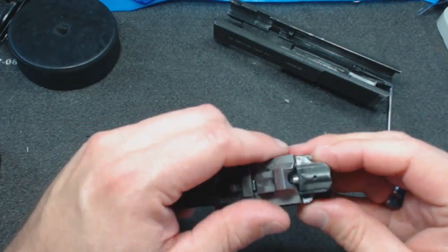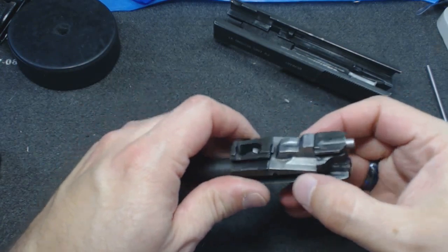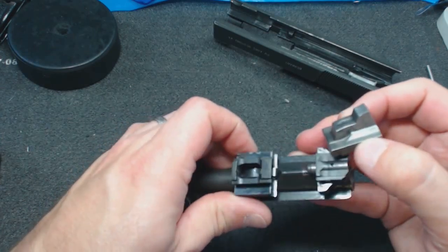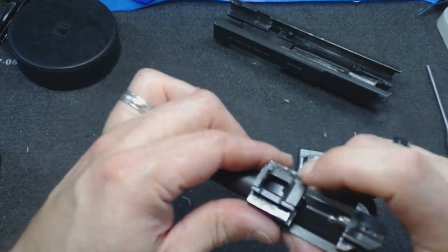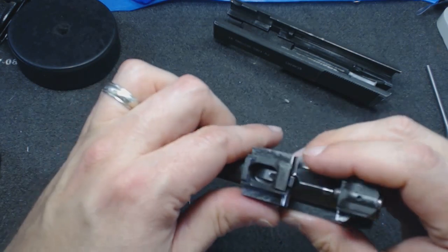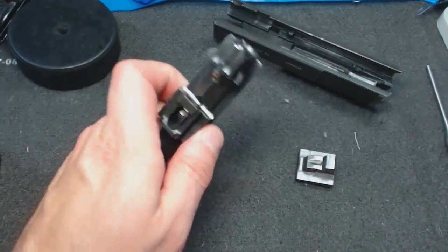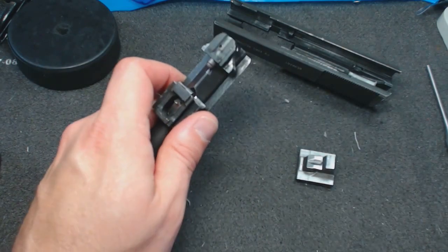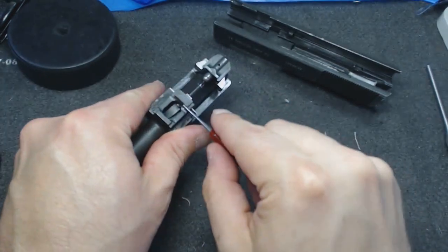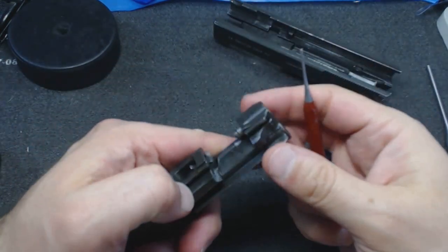What's holding this in place is this spring clip. If you activate it, you can pop it out from under that little clip — there's not a whole lot of pressure, it just sits in there and hangs onto it. If we really wanted to, we could remove this clip, but they're kind of hard to replace and they've been out of them at most parts stores on occasion. I don't really want to do that right now. If you had to, you'd slide a small punch in there and pull it forward. The spring would go down enough and putting it back in is just the opposite — squeeze it gently enough to get it under there and it'd pop right in.